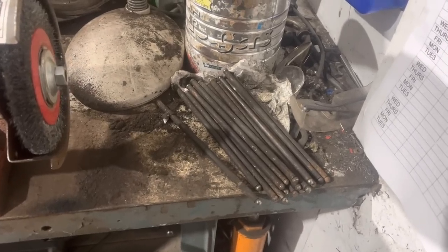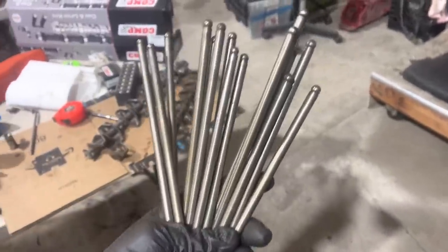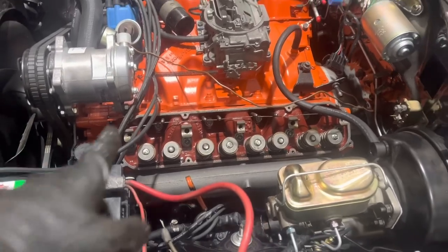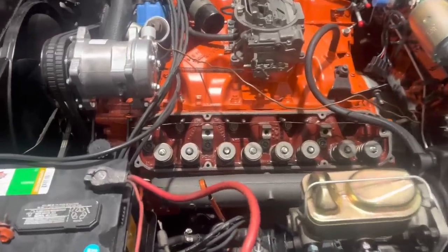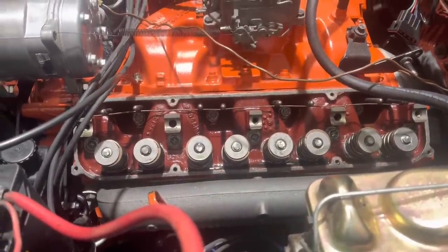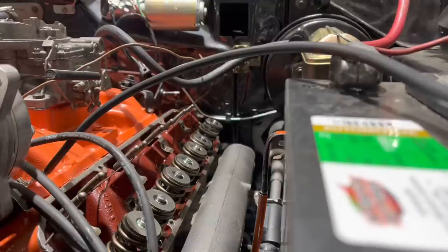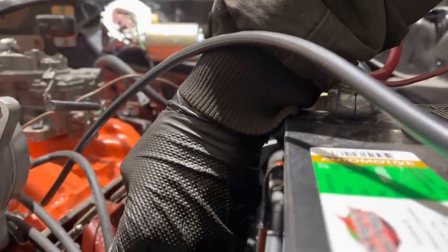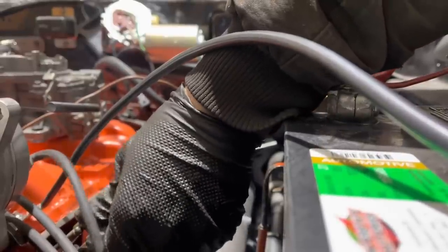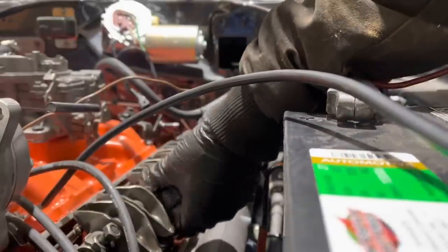I have to clean all these random ground-find pushrods and get them ready to put in the fresh new engine. I did go ahead and put a blanket on the car because now it's right in the way. Those actually cleaned up really well. Now for a brake clean bath, and I'll put them in the driver's side and make sure I'm right. This operation is sure easier on small block heads where they have holes that keep the pushrods roughly in the right spot. I learned this trick from the one and only Steve Dulcich: use a length of mechanics wire to hold the pushrods roughly in place, then do the rocker arm flip — hook them all under the springs like so and walk them up. So much easier than yelling at it like I did for five minutes before I remembered the wire trick.